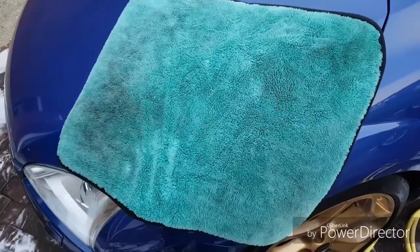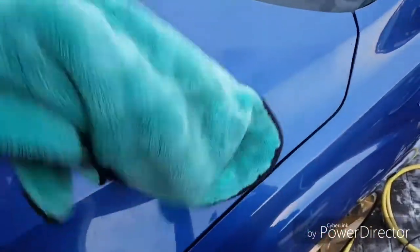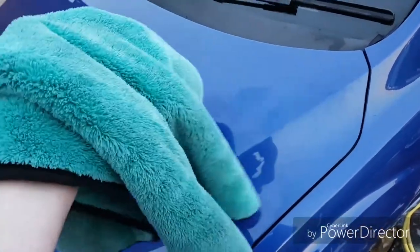After you've done that, you can dry the bike off and just give it a good shake down. I'd normally take it for a little run so that I can make sure all the water's out, then give it a little dry off. For drying off, I've got this massive plush Auto Finesse towel. It's really absorbent — you can stick them in the washing machine on a normal wash and you can do a whole car or the bike easily.